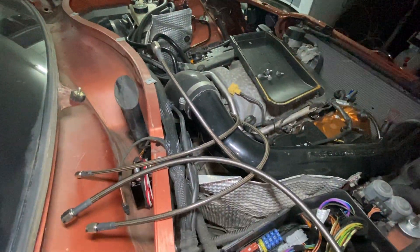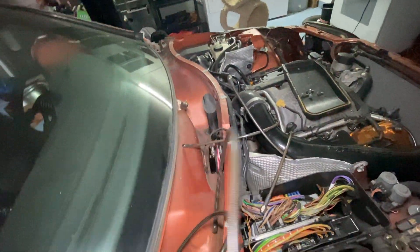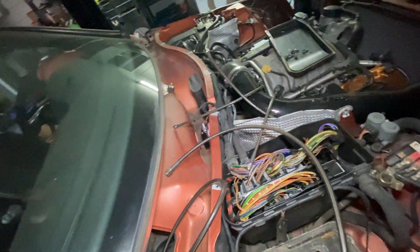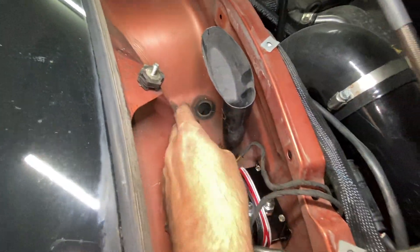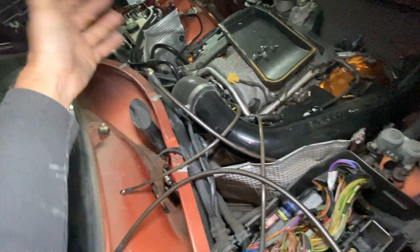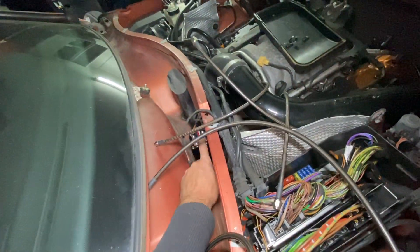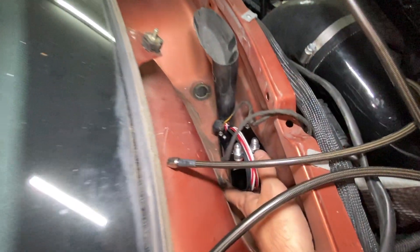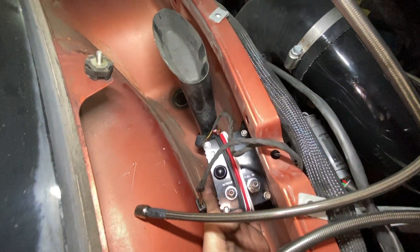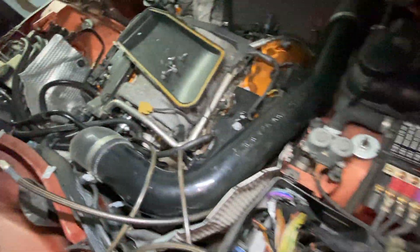Alright, we got all the lines kind of mocked up. Here's the nitrous feed line coming out of here — goes into the cab to the bottle. I was gonna run it on the driver's side underneath and come up because I have the perfect holes and grommets back there, but the issue when I first ran it was the whole exhaust. I don't have to heat wrap because the bottle heater will keep the lines at proper temperature right when they come out of the bottle, so I'm not worrying about the exhaust overheating the lines. This thing fits perfectly. I'm gonna mount it so I can see the programming light, and that should be perfect for fuel in, nitrous in, and then the outlets.